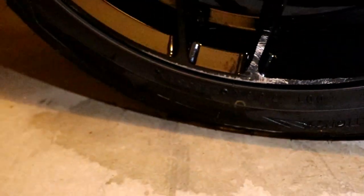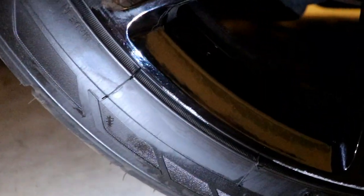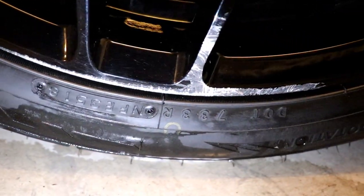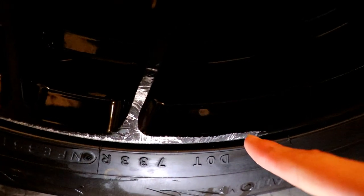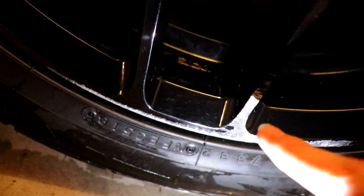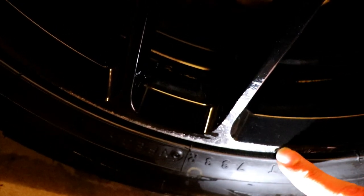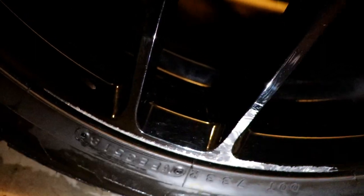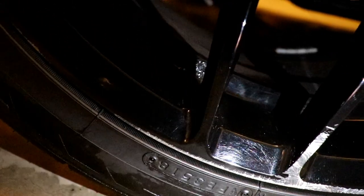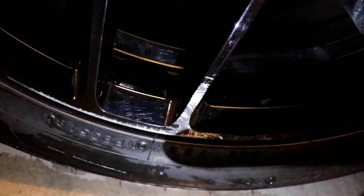Assessing the damage after we cleaned it up — from a distance it's not too bad; it looked a lot worse dirty. The damage is just along the outer rim, and the worst piece is one spot right here. The good thing is it's not deep at all — it's literally just the top layer, the powder coat. So we're thinking: sand this down until it's smooth, then use a small brush to touch it up, rather than masking everything off to spray paint.